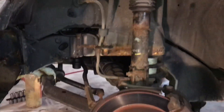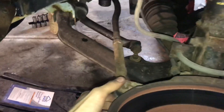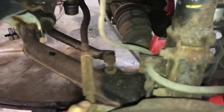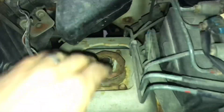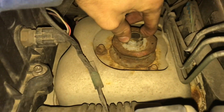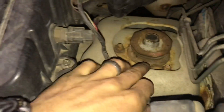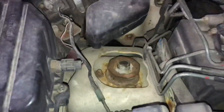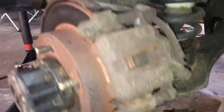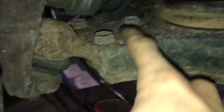There's an easy way to do it and a hard way to do it. The best and most simple way: disconnect your steering linkage here first, then come up here and break this big nut loose on the housing on top of the strut, because later on you're going to want to shove those studs out.